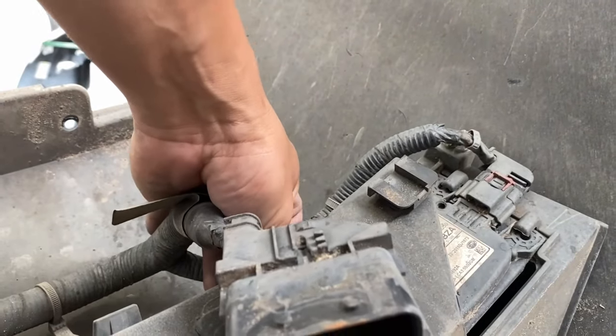And then don't forget this weather strip. Keep following and remember these tabs — just pull up on them. I'm going to continue pulling those and taking the sensors off. If you have one of these panel pry tools, you can use this for those little tabs — it'll be a lot easier for you. You can use this one to pull off rather than just a flathead — it's going to be a lot easier for you.